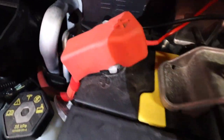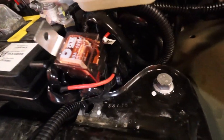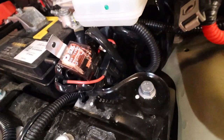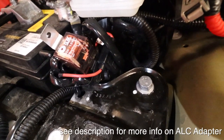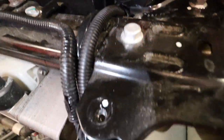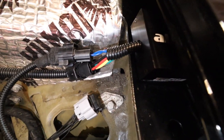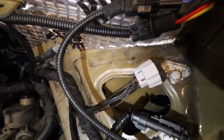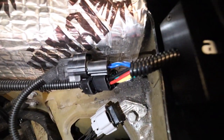So the steps I did: following from the battery and that's the ground. Everything goes over here to the cable, the wiring harness, and the wiring harness is connected to the ALC. There's a switch where you can turn it off and on, and that goes down here to that ALC box — this is the brain behind it, instead of using a canbus this is much better. Then it goes down here, there's a split: one is going into the light and the other one is coming back to the box.